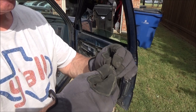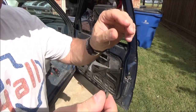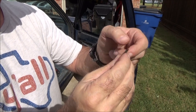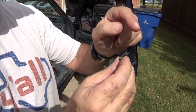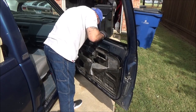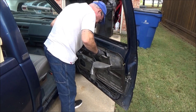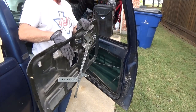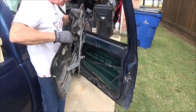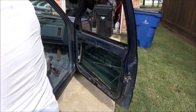The later model trucks got away from these clips. This is the latch right here — you've got to pull that up, bend it a little bit, which is okay, and then push this back and then the bar pops out of it. Then you're just going to have to bend it back and drop it back in when you put it back together — it won't hurt it. You have to have it all the way down. Slide this forward and then pop it out off the bottom of the window track. Then slide this back and there you go — you got it right off. You don't have to bend it like when you're at the junkyard.